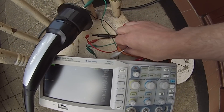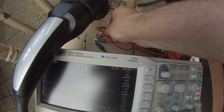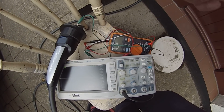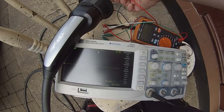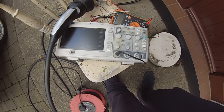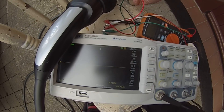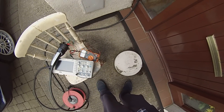First things first: if we connect up straight into state C — so as you would if your vehicle just had a diode and about 880 ohms between control pilot and ground — then what happens is, look at our scope connected up here and we get pretty much nothing. I was connecting the wrong wire — connecting this wire now.